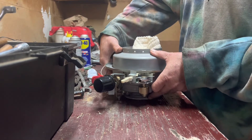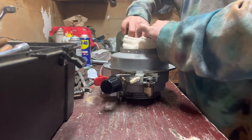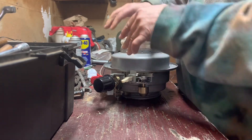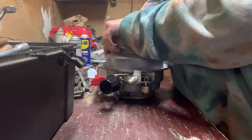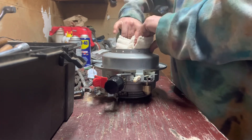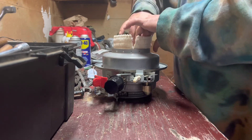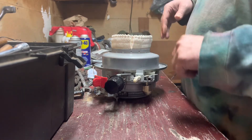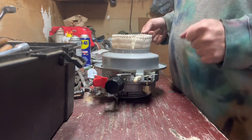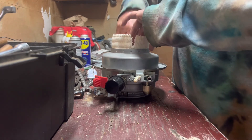So I'm gonna tip her over as such. Now we have to go ahead and stick this wick onto these other pieces here that are gonna hold it where it belongs, so that part of it is gonna go ahead and dip down into the kerosene. The problem is these things don't want to grab it. They're probably gonna end up grabbing it as that big round cylinder thing on the heater goes ahead and holds this wick.